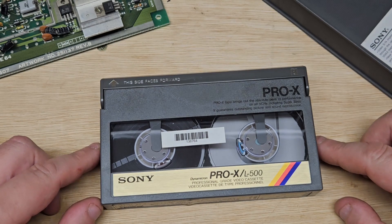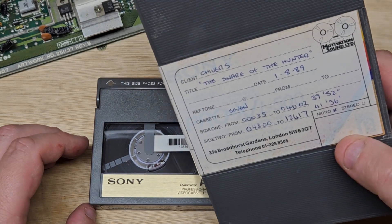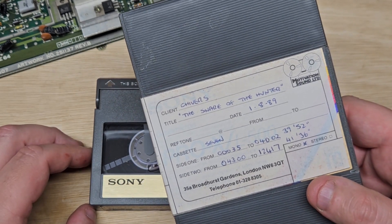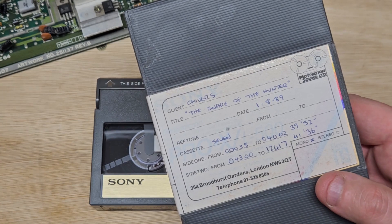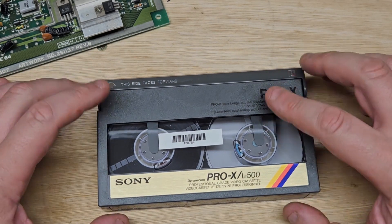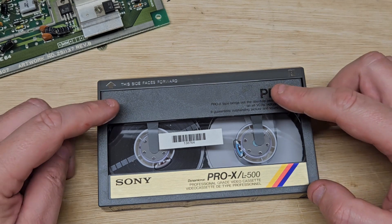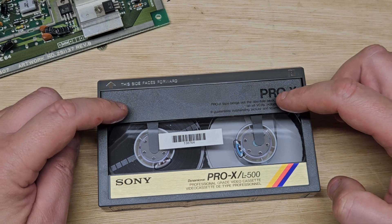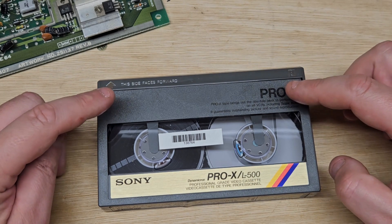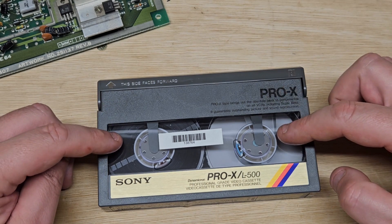Now these tapes are at least 35 years old. This one here was actually recorded on the 1st of the 8th, 1989, and this was a tape that had PCM data on it, so it's well over 34 years old. I don't see it as much with the more consumer ones but it still does happen. What happens is there is a plastic tag inside the cassette which pushes the tape up against the little pins inside, and the glue that holds that plastic in fails and it then gets mixed in with the tape and damages it.